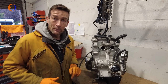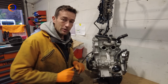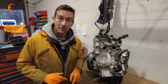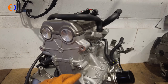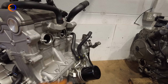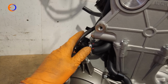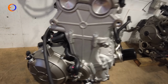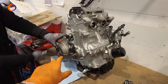Welcome back to our Aprilia Supertwin fast bike build, and today we have the engine on the bench because we're going to take the head off because it's going away for a bit of gas flowing. The first job though is to strip a bit of the unnecessary stuff off it, so some of the emission stuff, so the pair valve pipe work can come off it, the solenoid can come off it, and I'll whip off a couple of water pipes and bits like that just so we've got less stuff to clutter up the bench. Rob is just taking the clutch cover off.